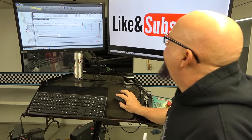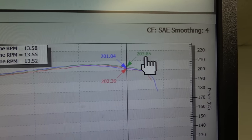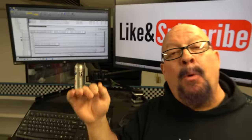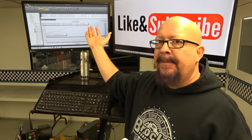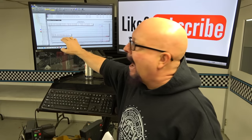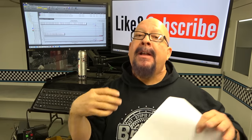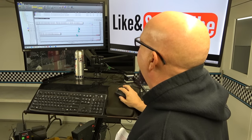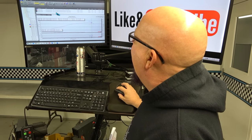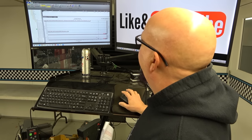Okay, so looky here, we can go in and compare 201. Now we got 203 up here in the over rev, so we were able to tune a bit more peak power out of them. So are the printed carbon fiber stacks bad? No, they made more peak horsepower, but I'm not willing to trade that peak horsepower for that big a loss in the middle, if that makes sense. Let me go back and let me rescale this stuff. Now, I'm gonna go ahead and leave the optimized printed stacks.